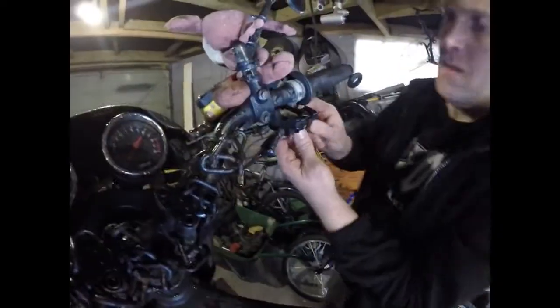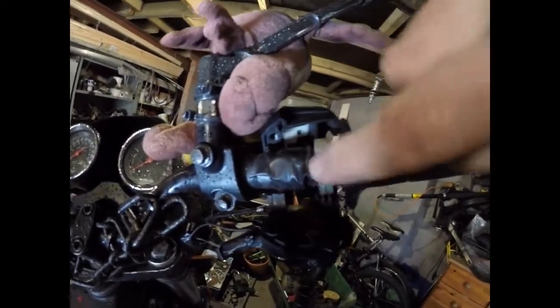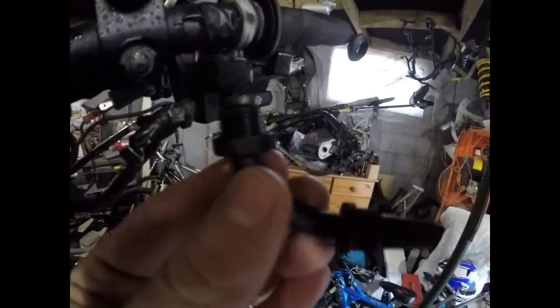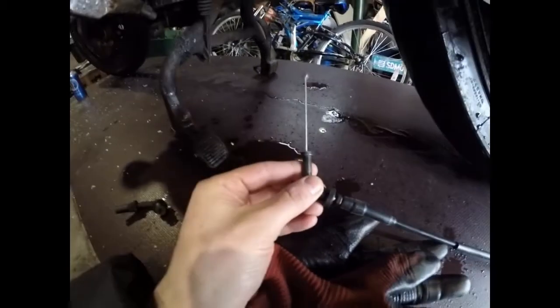So we've got the K8. As you can see — if I come round — just put your thumb under the casing, that's a little trick to stop it spinning. As you can see there's your casing. One part of the throttle cable goes in the bottom, and the other one's in the bottom too — it's a two-part cable. Obviously the other cable had snapped. Normally your cable would go through this adjuster to adjust your cable. This is the old one, and when you buy your new one they've kindly put a new adjuster with it.